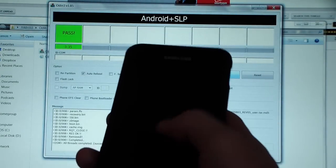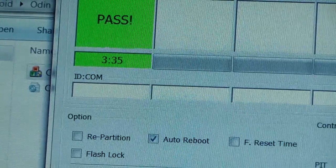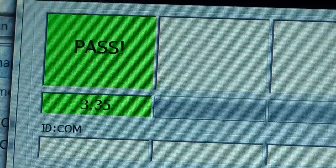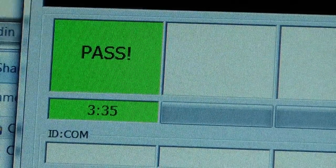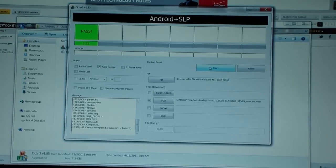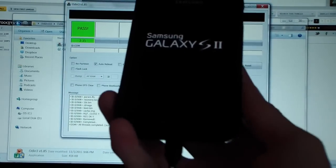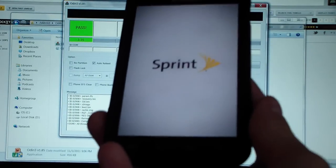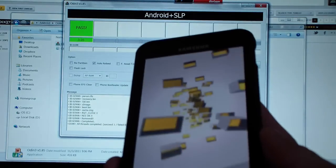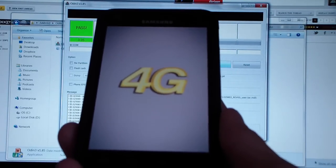It just finished — my phone is rebooting now. It took 3 minutes and 35 seconds. It might take longer for you depending on your USB cable's transfer speeds. If it takes more than 20 minutes, something is definitely going wrong. Once it reboots, I'll show you that I'm completely back to stock EG31 — no root, no ClockworkMod. If you try to get into ClockworkMod, you'll get into stock Android recovery.